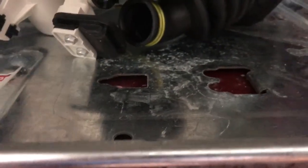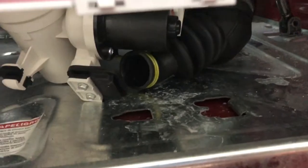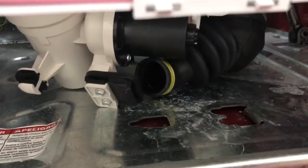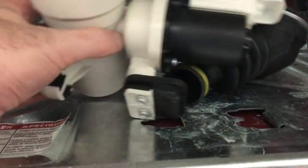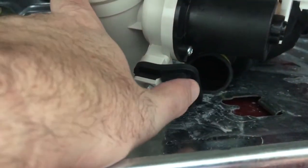Waterproof grease is amazing — good for showers and everything else. Apply the grease into the grooves, which gives a much easier way to do this without tearing up your hands and gives a better seal on the unit. These hoses give you almost a directional unit — there's a black notch at the end at the top. The clamp's middle part has to be moved all the way up. Once you get the hose into the male portion of the underside of the drum, you should be able to maneuver the clamp over.